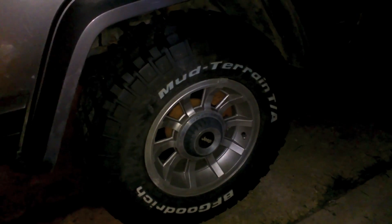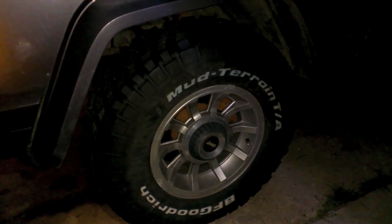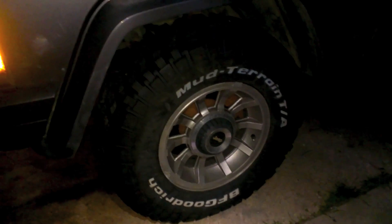It's pretty simple — a little bit to do with geometry. This right here is an oversized tire. This tire is bigger than the tire that came on the vehicle out of the factory. This is basically a 29-inch tire — it's a 235-75R15. I know it's metric, but it's basically a 29-inch tire. So since I want a bigger tire, you're going to have to change what's called a speedometer gear.